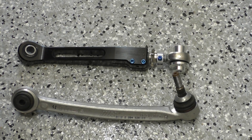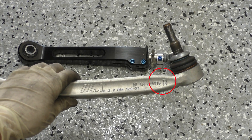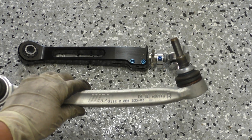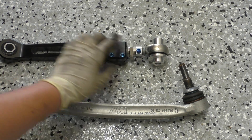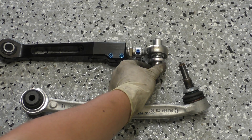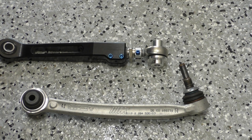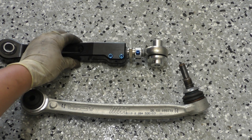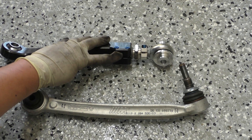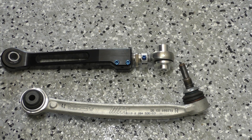So looking at the arms, how do you know which one goes where? If you have an OE style arm you can see there's a little 'R' on there designating the right side or passenger side for left-hand drive countries. On the SPL, you have to look for the spacer with the O-ring on it that goes into the control arm — there are no other markings. This one goes on the side with the headlight leveling sensor, which for left-hand drive countries is the left side or driver's side, and that headlight leveling sensor plugs into this little hole right here.